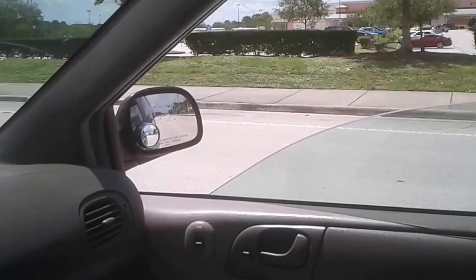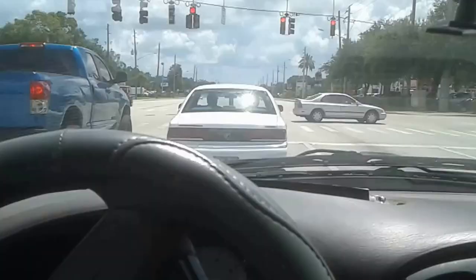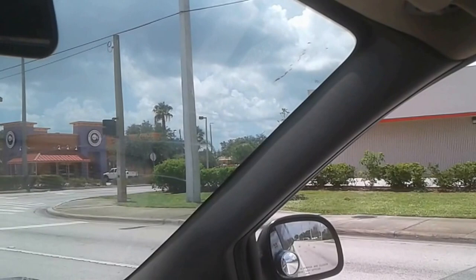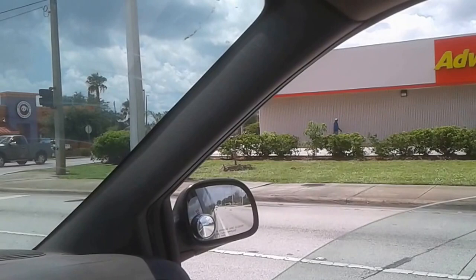Here I am charging the battery system. You can see I have my windows wide open, so I'm not really too worried about poisonous gases — the wind will blow through and push the air out the back windows, which are open. My switch right here is set to on, so the two battery systems — the house battery and the vehicle battery — are currently connected. The alternator is charging the vehicle battery under the hood, and then the vehicle battery in turn is charging the house battery in the back. That's how the system works.